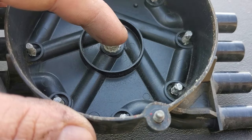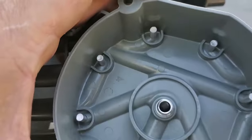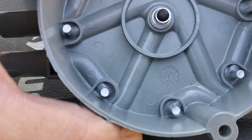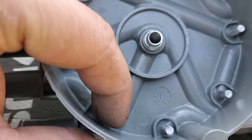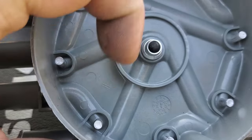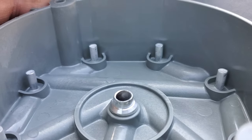Right here it's completely flat — there should be a little deal there. Let me show you on the new cap. The new cap has perfect little cylinders right here — the little pegs are completely brand new, there's no extra gap, and you've got that little contact point that makes contact with the contact point on the rotor.